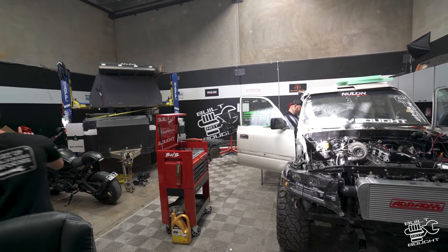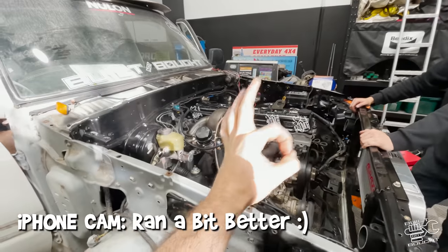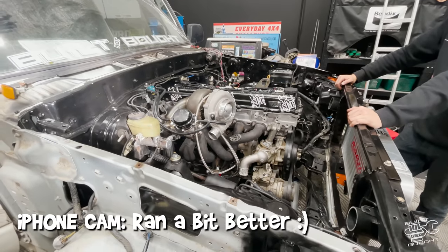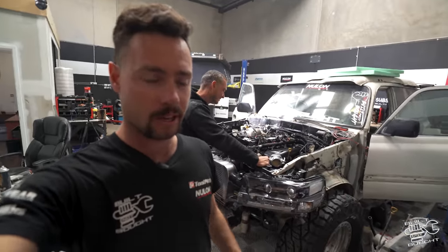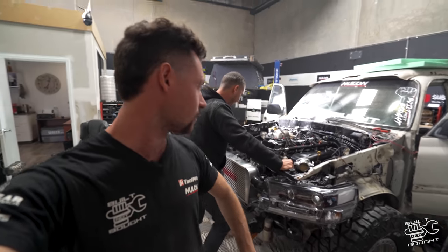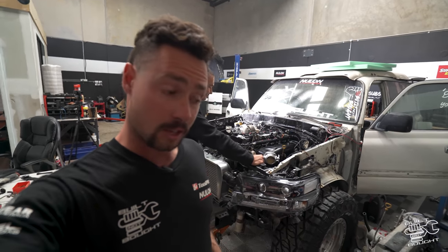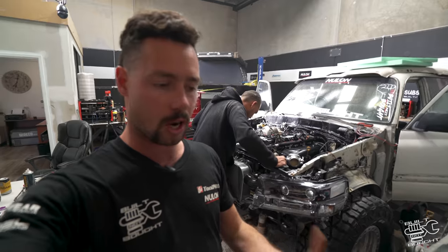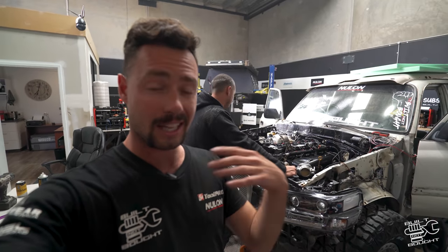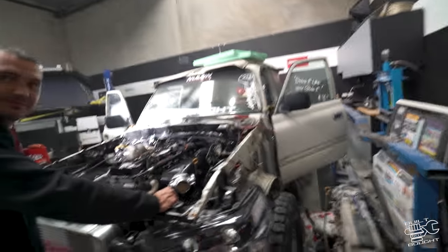Yeah, that was rough as. It didn't sound like smooth six cylinders. Sounding heaps better. I've just realized this build has been happening for like eight months. This is the first engine I've ever built on my own — she fired up. A bit of tuning issues, wiring issues, but we got there in the end. It doesn't sound amazing, but obviously this is where you start actually doing things with the tune. Got to find a dyno tuner now, get it sorted. We've pretty much got to go through and do the water system so I can actually drive it. You don't want to keep running these things just idling because you can kind of glaze the bores, so we need to run it under load — get all the cooling in so I can drive it, put it under load and bed the rings in. But yeah, it made the right noises and that's a tick in my box.